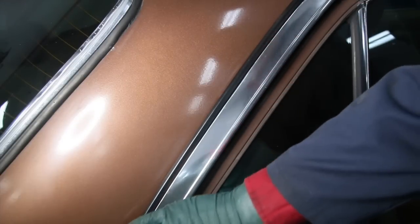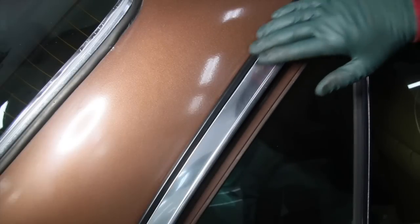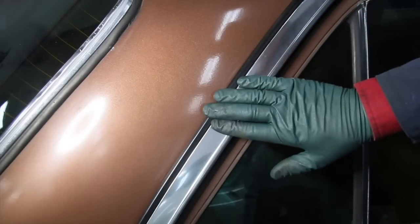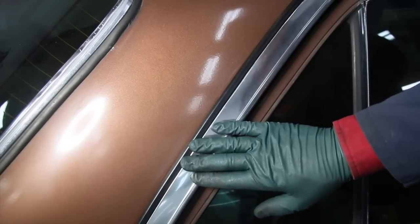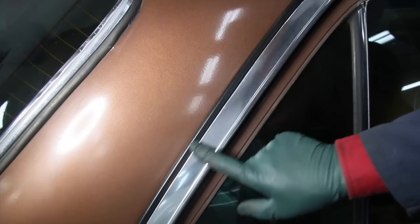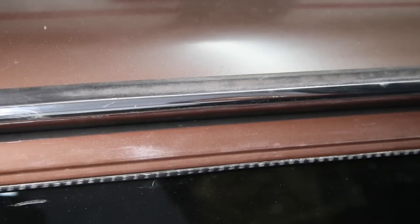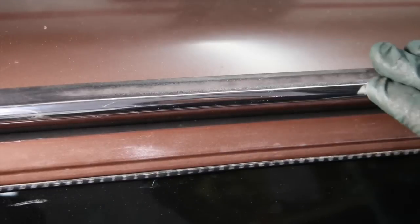This really hard plastic trim on these older models like the W114, W115, and W123 can get looking very grungy and very faded. Look what I've done to this — it's been polished with Acrylic Werks. I didn't have to buff it too much. Of course I cleaned it a little bit with a cleaner and then came in and really started rubbing with the Acrylic Werks to get this nice sheen. I know it's hard to show this on camera, but see all the fading and discoloration — that's what you're going to see on most of these older Mercedes-Benzes.